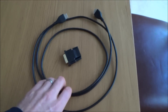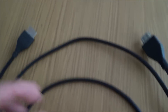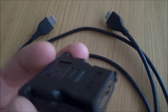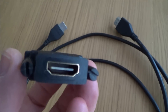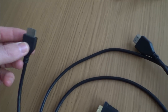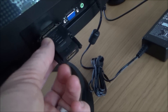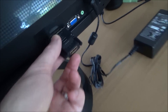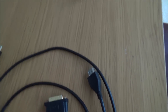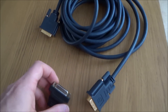If you want to use the HDMI lead that came with the Xbox, you can buy one of these adapters. This is a male DVI to a female HDMI adapter. This side would plug into your Xbox, and then this end would plug into the monitor. You would then plug your HDMI cable straight into there, so it ends up converting the HDMI over to DVI.